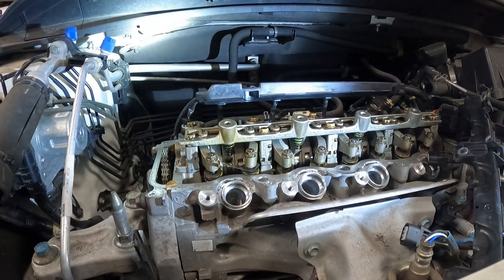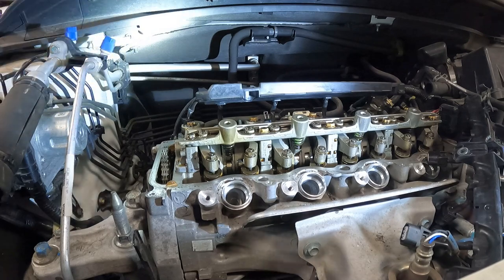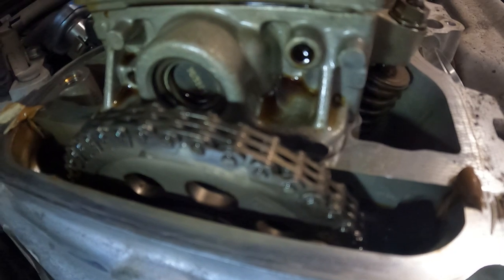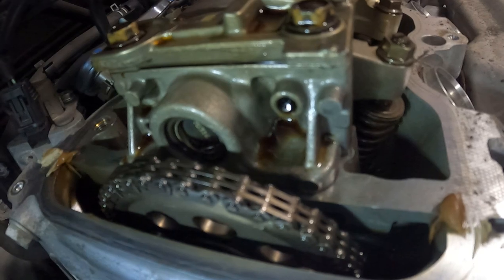Now, before I finish adjusting the valves, I'll actually show you. On the 1.8 liter, it actually tells you the cylinder you're on all of the time. So before I rotate it, I'm gonna take my adjuster tool out. We will move back over here and we will rotate it, and you'll see, if I go with the camshaft, a quarter turn. Now I don't know how well you can see the number, but that's a three, and there's another line right here, and that's saying that that's cylinder three, top dead center. And we'll rotate it again.